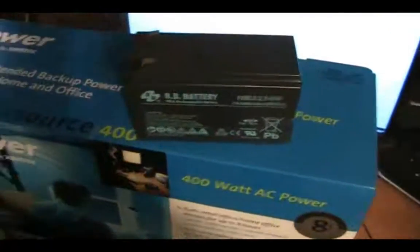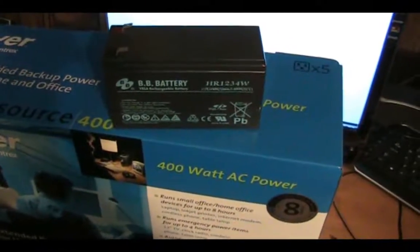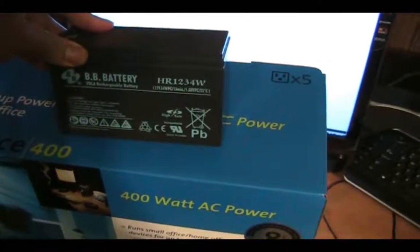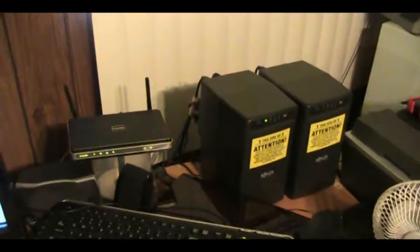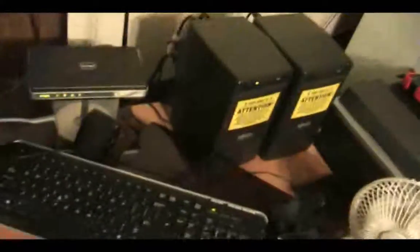Here's what would be a normal size battery for a 650 VA UPS — this is probably a 9 amp hour battery. I don't know if a 650 has an 8 amp hour or a 9 amp hour, but pretty much similar to this one. Pretty much the UPS will be around that size and will be able to run your computer at only half load for 15 minutes.